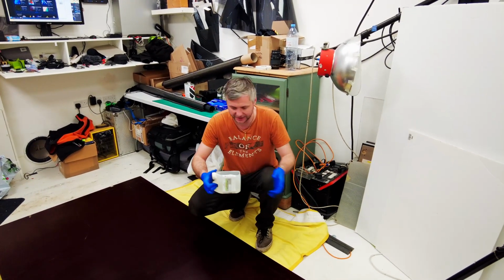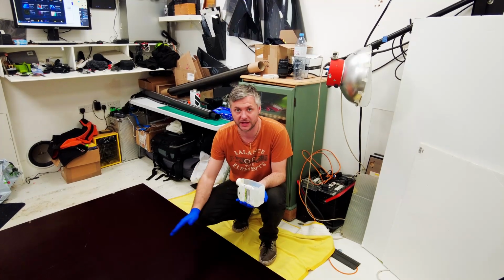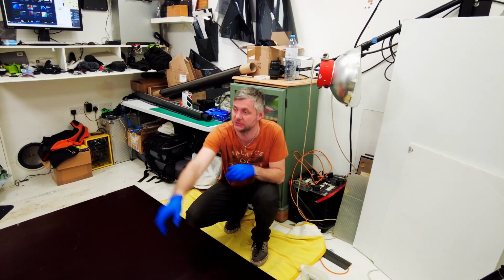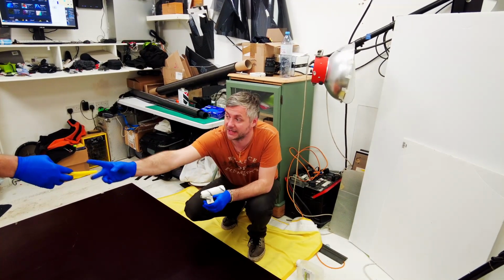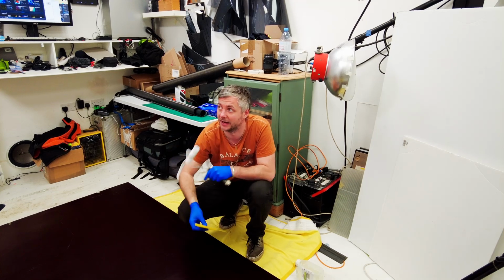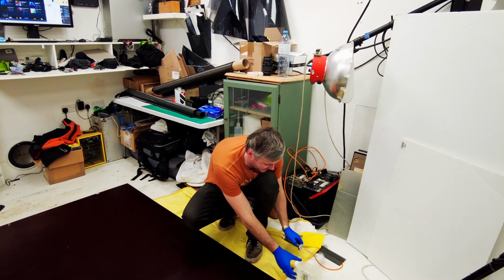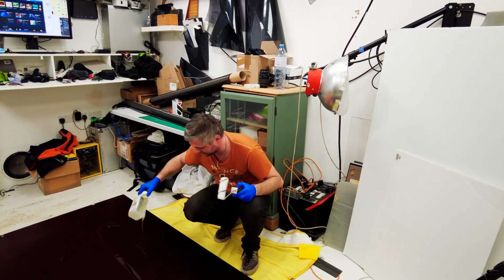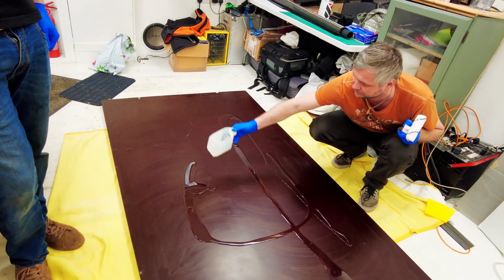Now we need to apply a thin, firm layer of resin onto the mold before we put the first layer of reinforcement. For that we can use a number of tools. Nick, would you pass me those 2 tools? Paint roller, perfect for flat surfaces, or a spreader. One of those, again, link in the description, Amazon affiliate, cheap buy. You literally just spread it as uniformly as you can. You can literally just pour it on. Imagine it's kind of like icing a cake.